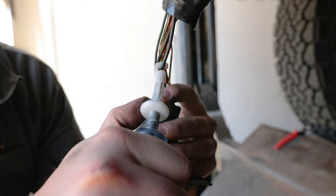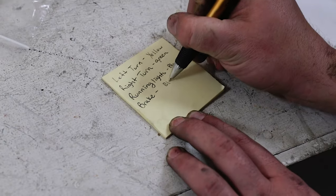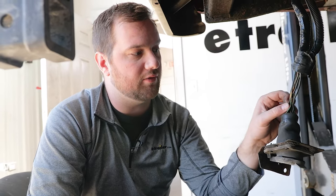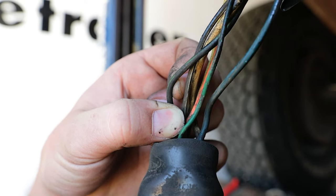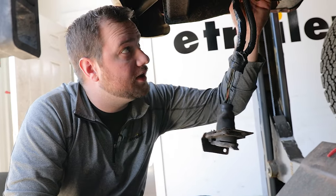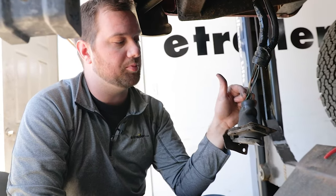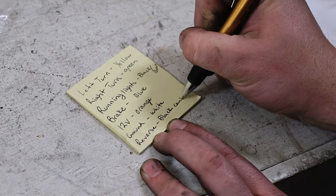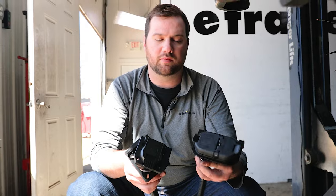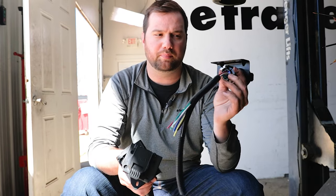For our brake wire we do have a blue one here, so we'll go ahead and test it since that's normally the standard. The only two wires left to test are our large white wire and a black wire going into the center of our seven-pole. We know our large white wire is connected up on the frame with a self-tapping screw, so that's our ground, which leaves our center pin to be our reverse lights. When getting ready to connect your wires, make sure to check the functions on the seven-pole itself based on pin placement.